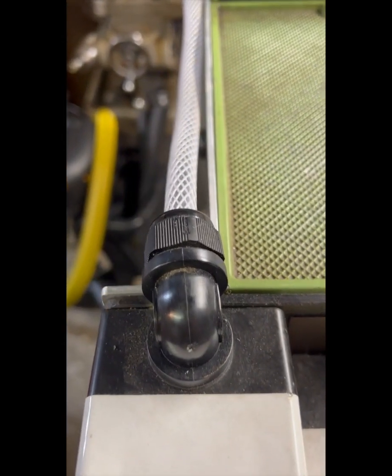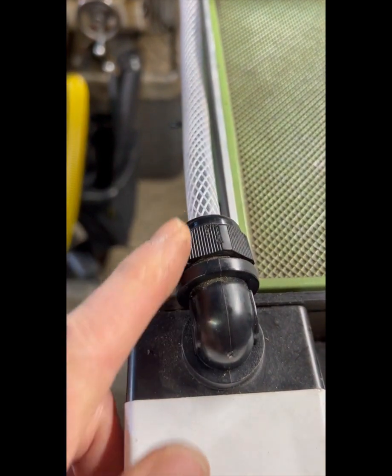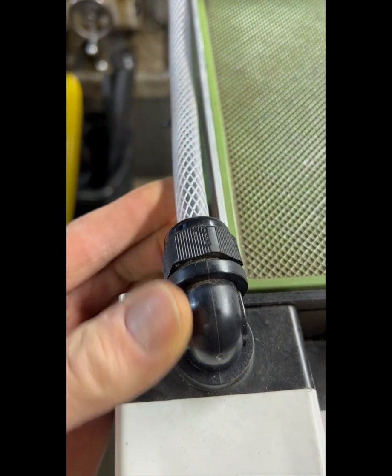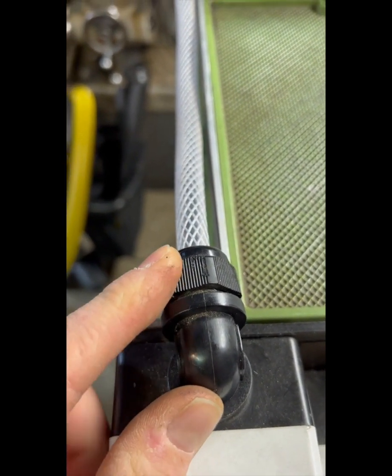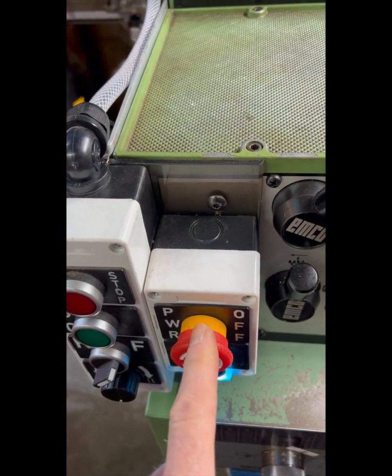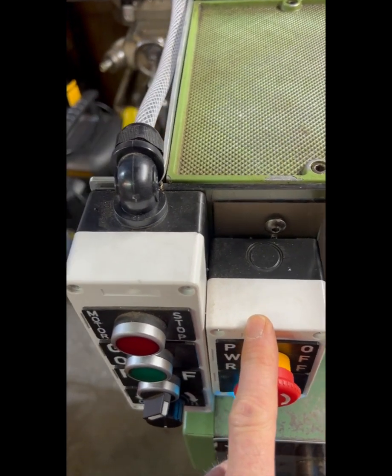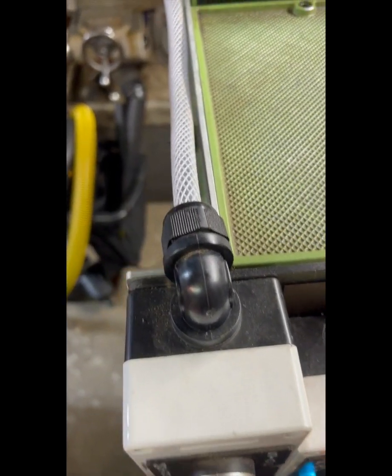The front panel is connected up to the junction box in the back of the Super 11 by this hose connected to a gland connection, so all the connections are watertight. I chose not to go through the face, as others have done through the original switch hole, because I found it a little bit cramped for the number of control wires I was using.